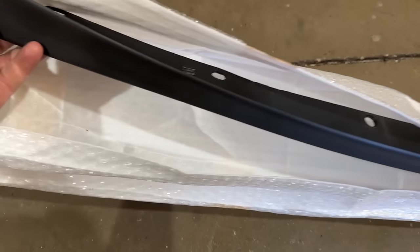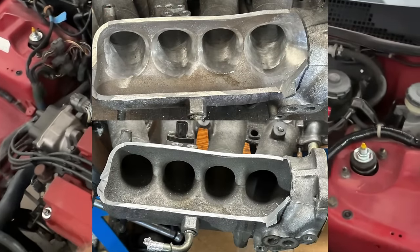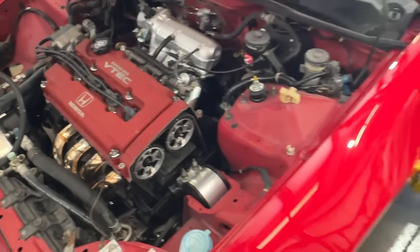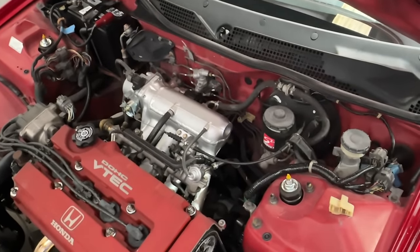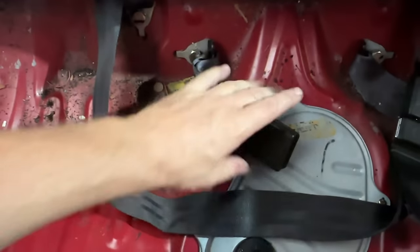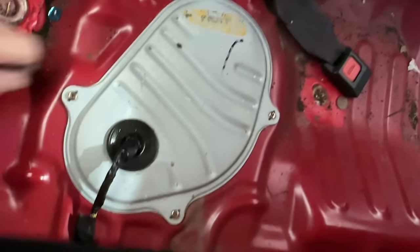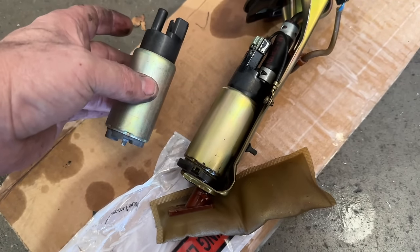In the bag — a front lip for an EG, should look pretty cool. This has the cut-open intake manifold. We're running S2000 injectors, so it's an OEM injector with a little bit more fuel capacity. Also going to do an S2000 fuel pump — one, because it's OEM reliability, and it fits directly in the tank, and two, it's going to need a little bit more fuel. EG guys are spoiled because your fuel pump is right here — pull the seat up, four screws, a few turns, fuel pump is there.